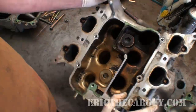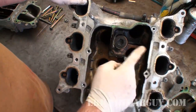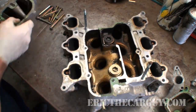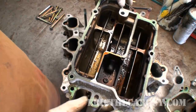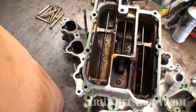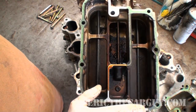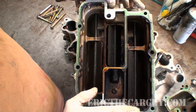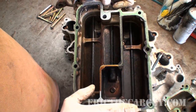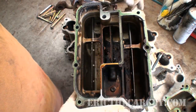So this is basically the design you have here. Each one of these holes goes to each one of these other holes. This gives us the ability — if we're in a high-horsepower situation or we have a demand for lots of horsepower — we want it wide open like this. If we want more torque, we can close these off and we only get air through here, which helps restrict the airflow coming in.